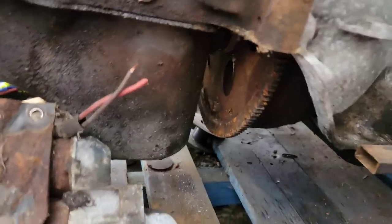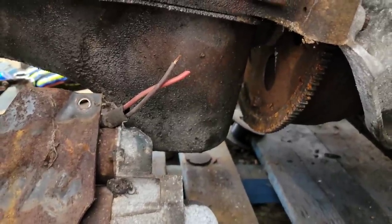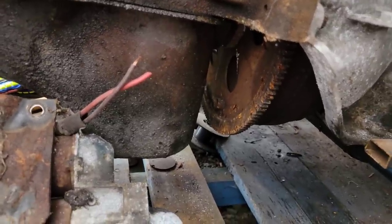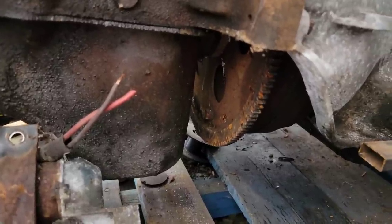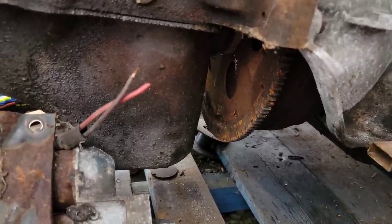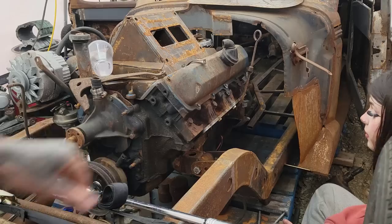Now, with the starter out of the way, you can see the bolts. Well, one's there. There should be three on this. I think there's some GM torque converters that had four, but I'm pretty sure there should be three on this. I've seen some with six, but basically spin the motor over until you hit those, pop those bolts out, and you want to make sure you get all of them out and keep spinning it until you find a hole without a bolt in it to make sure you've gone all the way around. Nothing sucks worse than getting the tranny half off, finding out you missed a torque converter bolt. Yep,